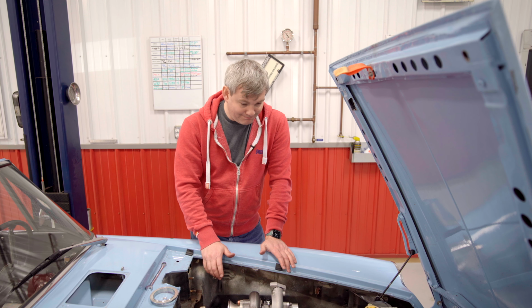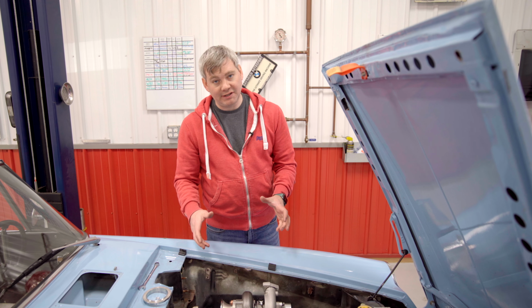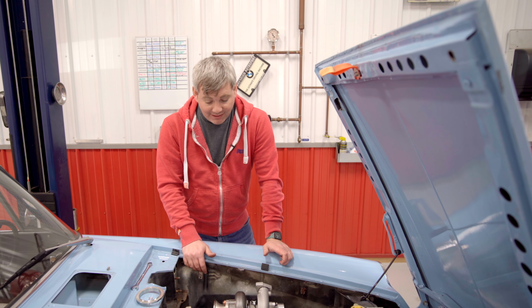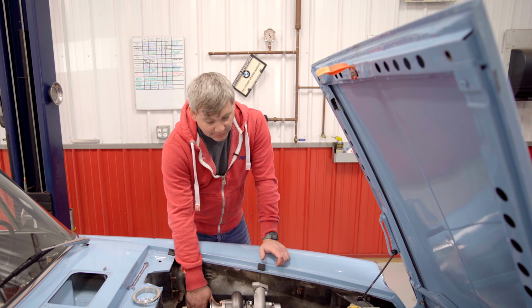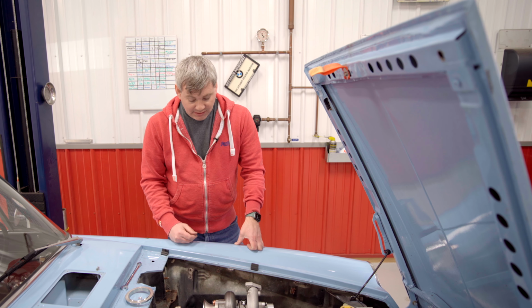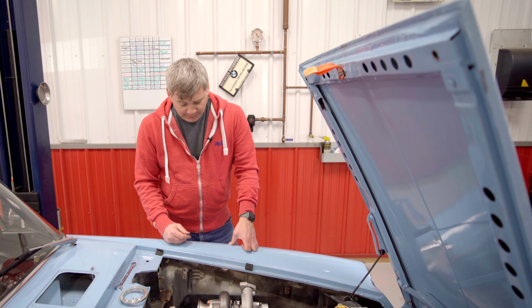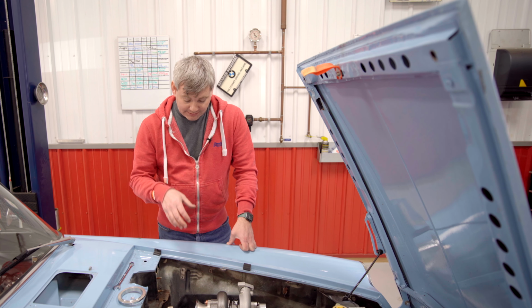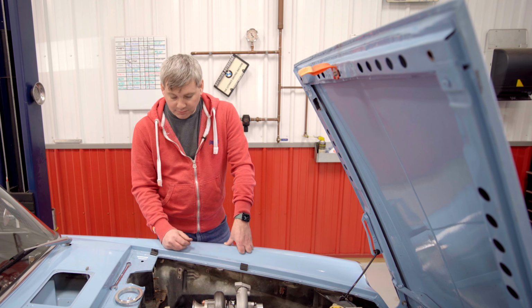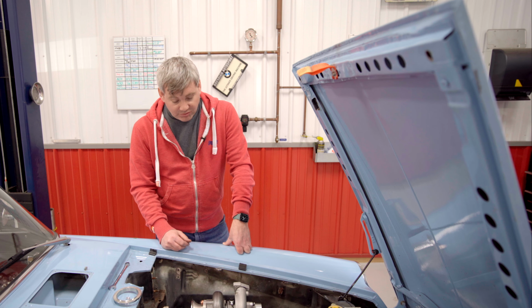This is just box, non-chassis, non-structural related stuff. I'm gonna cut it out, weld in, obviously, back in reinforcement to make it better than where I left it, but I am going to open that up so I can run it on the outside of the steering column. Just try to buy a little bit more airspace in general, and I think that's going to work out really well. So pull the turbo back off, start creating that hole about where I think it needs to be, and we may have to die grind out a little bit to get it to fit, but I think it's going to be a good fit once it's done. So start fabbing up that downpipe.